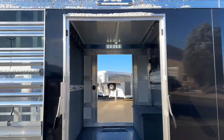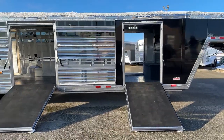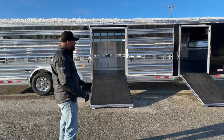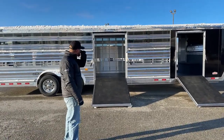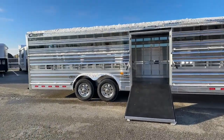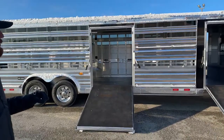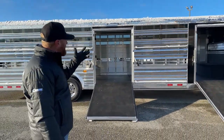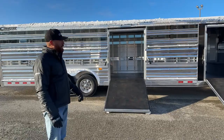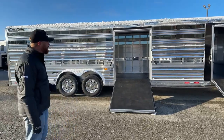Coming out of the ramp, there's a 16-inch awning light above going into the tack room, and another one going into the ramp into the stall area — so you've got a couple exterior lights on this trailer. Believe me, you are going to be doing something in the dark, so loading and unloading it'll be nice to have those. We added a few extra LED button lights to the top rail — honestly it makes the trailer look sharp. They're small but put out a lot of light — not a big power draw being LED. They're spaced about every three feet on this trailer. We've built some with a foot on top and a foot on the bottom, matching — looks phenomenal at night.